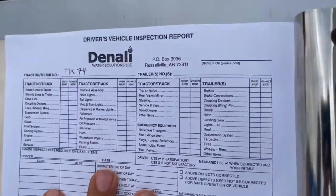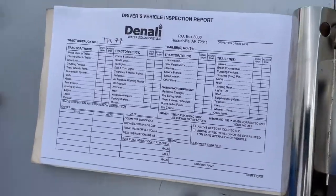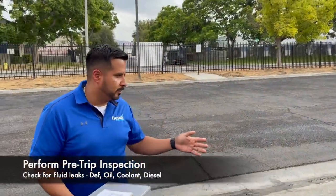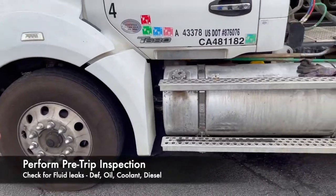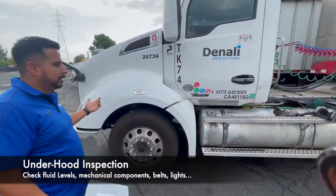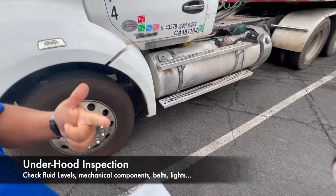Hey, how's it going guys? We're going to do a brief demonstration with junior here. This is generally what a driver looks at and we're using this as a general reference. For you guys, since you won't be on the road, the most important thing is doing a visual inspection — making sure there's no major oil leaks on the ground, no diesel leaks, no DEF leaks. You want to pop open the hood and check your coolant level and your oil level with the dipstick.